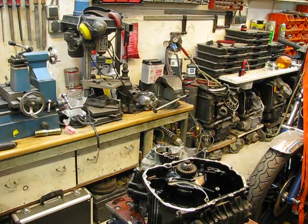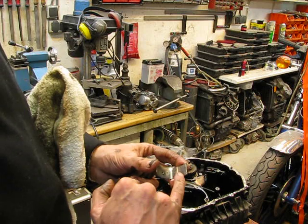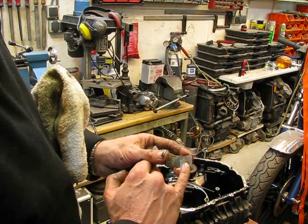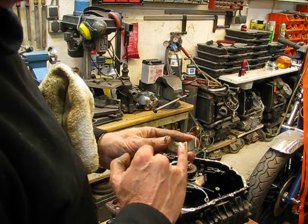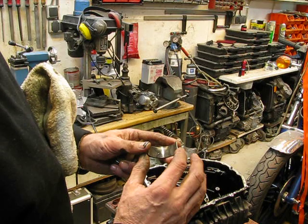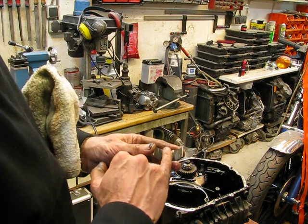But now the bearings. One of the bearing sets — look there. The engine is still running very well; you don't see it, you don't feel it, you don't hear it. That's a very soft alloy on top of it — you can scratch it with your nail. When that is ground away by normal use, you get a harder layer, like steel. And when that is gone, you get a bronze, copper, brass-colored product. That's the carrier of the bearing. At the moment I don't see the brass color, but there is a little spot there. And that tells me this bearing is worn out.